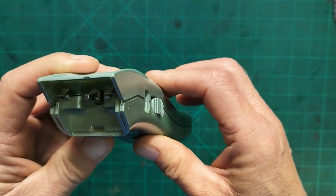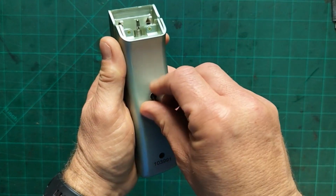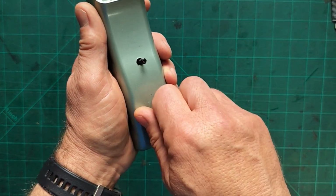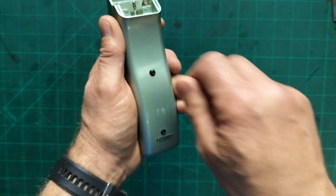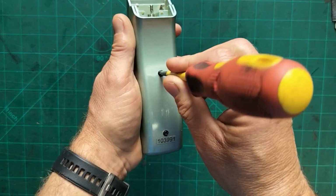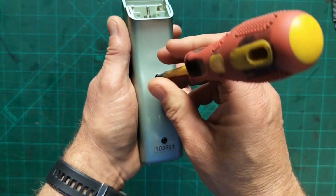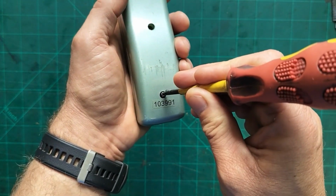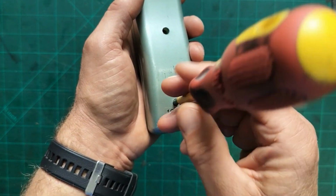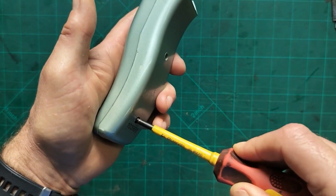And once I can see that everything is in place, which it feels like it is, we've got two screws to go in. So the two bigger screws, two screws there. These screws are going to go in. These are self-tappers. So when we put self-tapping screws back in, we want to go really gentle when they first start, because I don't want to make another thread. When they originally build these, it wouldn't have any threads in it at all in that plastic part, and as they put the self-tapper in, it cuts the threads, hence the reason they call it a self-tapper.